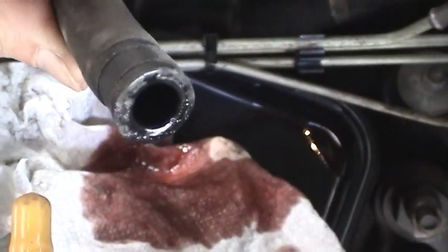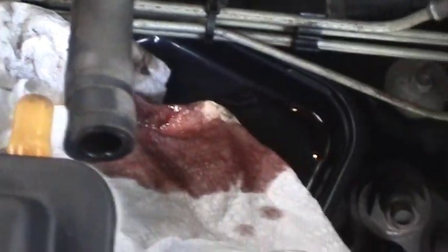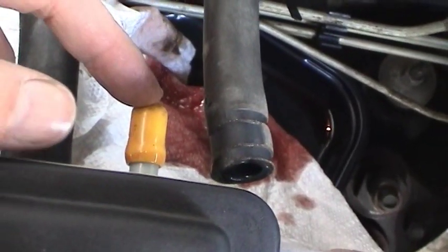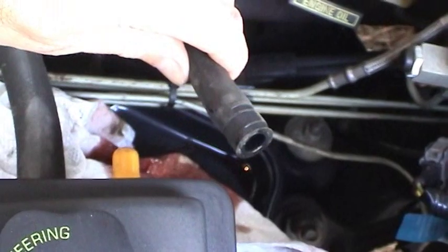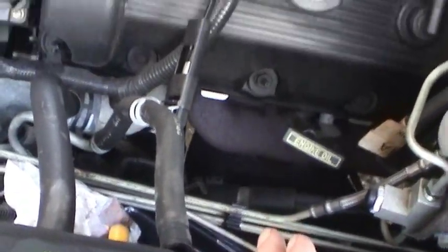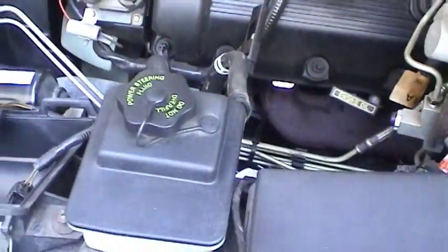What we're going to do is try to route this hose to a catch can. I may just go ahead and take the hose off entirely and use a junker hose, routing that down through the driver's side wheel well into a bucket. Some fluid came out but it was very well controlled. So I'm going to pop that off again, take a sample, and set myself up with a good drain strategy. I'm thinking I can just leave the engine off and run the wheels left and right with the steering wheel, and use the gear to pump all that fluid out.